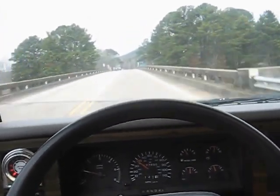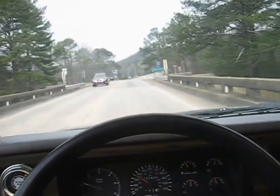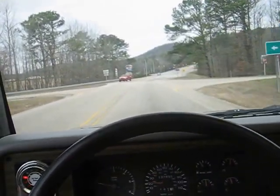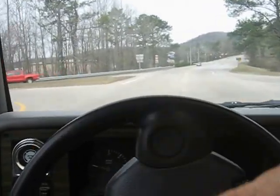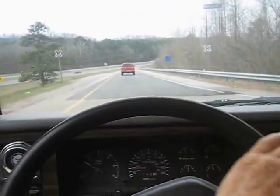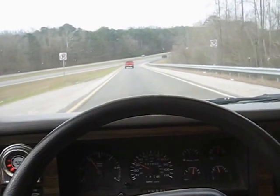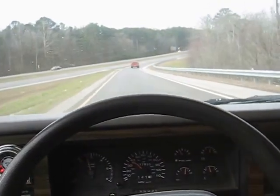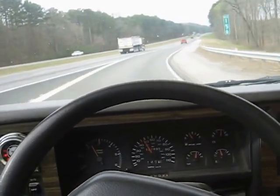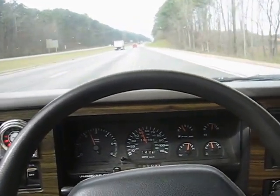Hello, Doug Doss wanted me to do a little video showing when I might want to lock out the overdrive. We're going to hit the interstate here and go over a mountain. Anything over about 45, unless I'm at full throttle, it shifts into overdrive. So it might be a situation where I want to keep up my RPMs but I don't want to be at full throttle.